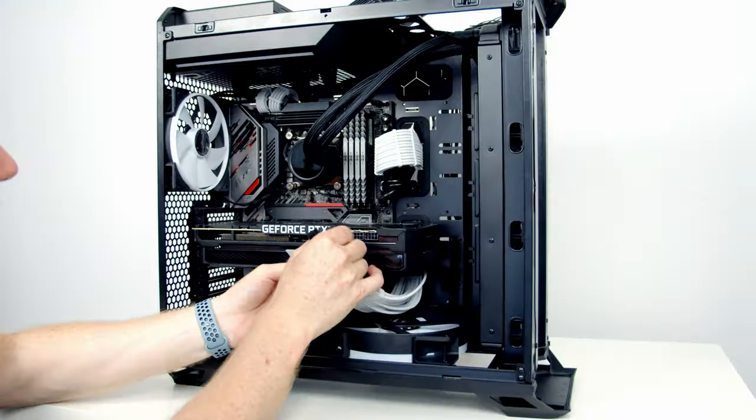So this has given us a bit more information about our case in that the front panel and dust filters are so unrestrictive, they don't make any difference to the temperatures. And this is what I would have expected. But it doesn't answer our question about why the CPU temperatures are so high. So whenever I had done this build, I had updated the BIOS to the latest version, and I wondered, could that have affected the temperatures? So I went back in and reinstalled an earlier version of the BIOS and ran the tests again.